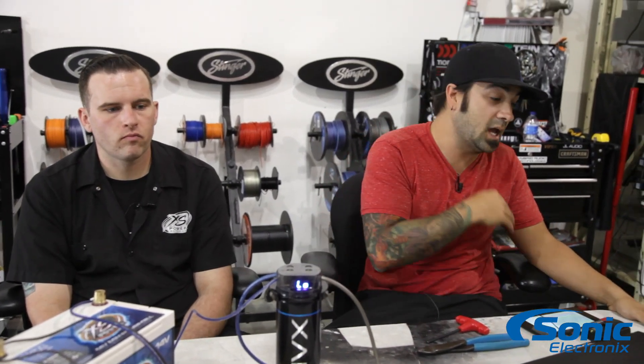I can give you an example — a long time ago we did a system in an M5 and no matter what we did, we had engine noise. It had nothing to do with a bad RCA or anything like that. We swapped equipment out and grounds were solid, but for some reason we couldn't get rid of the noise at all. So I made a call to an industry veteran, Larry Fredericks. He told me the only way to get rid of it was to use a half-farad cap and put it in line, and that would filter out that extra AC ripple that vehicle more than likely had. Sure enough, that's what we did and the problem was solved.